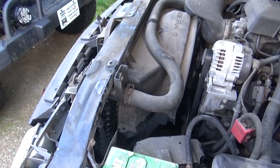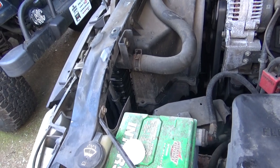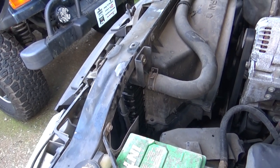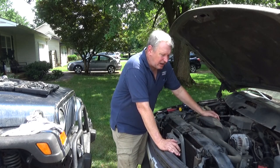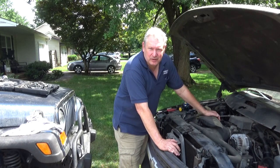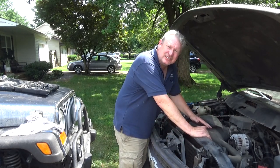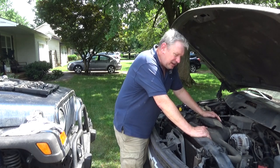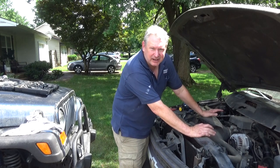It's a plastic radiator. I'll take off the cover tomorrow and the serpentine belt because it needs to be replaced, and definitely it's just coming out the side of that radiator like a bunch. You can't just go order a radiator for this vehicle because there are two, maybe three different ones, depending on the core size and the cooler. So I'm going to have to take this shroud off the top, take some of this covering off and get down to the nitty-gritty of the radiator so I can do some measurements before I can order it.